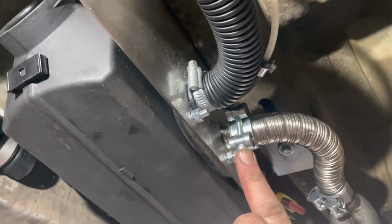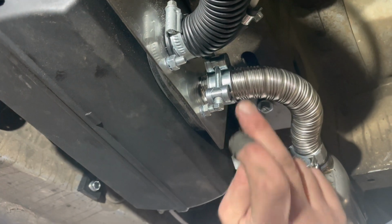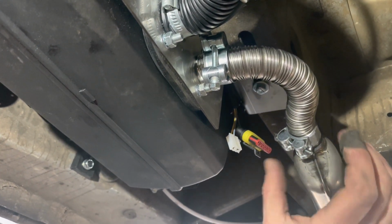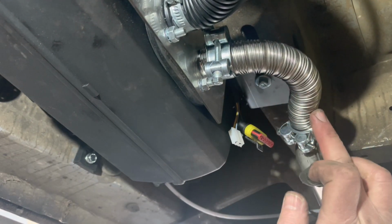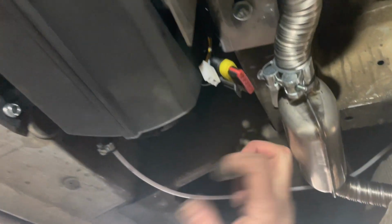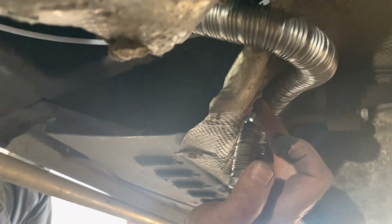What we've done now, then, we've put the exhaust pipe on. When the pipe comes, it's got a little slit in the end of it, so when you are cutting it down, make sure you put a little slit in it, and it clamps a lot easier. So put a little bend on there, silencer on there that's fastened up to the bodywork, so it's nice and solid. And then we've just brought it round through the gap in the heat shield, and to stop it from rattling and everything we just put another bracket on there so it's nice and neat.